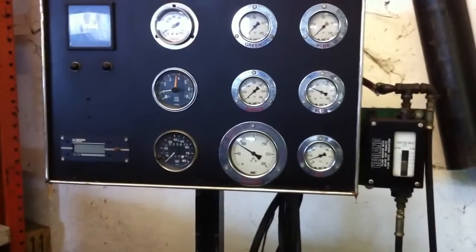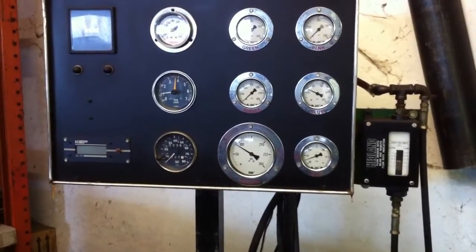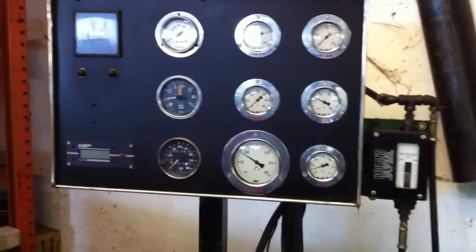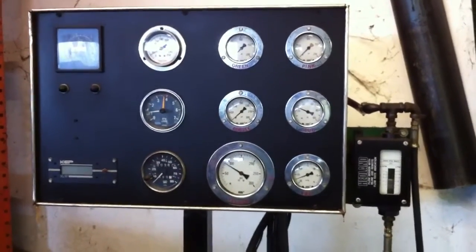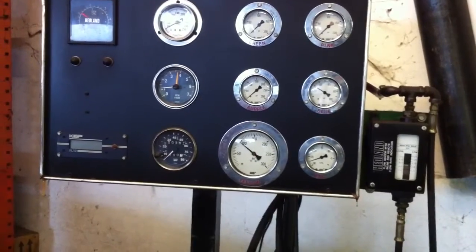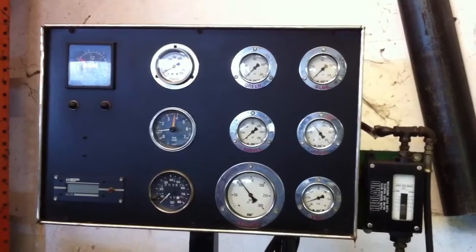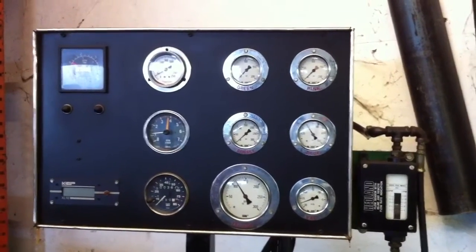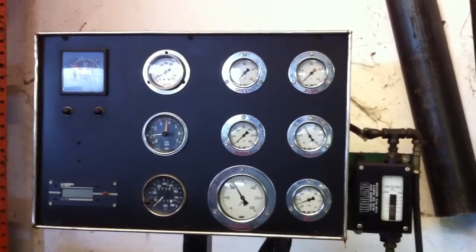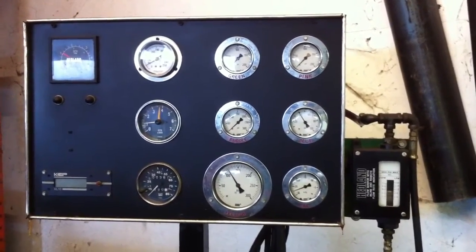In the van I was getting 85 psi. I did a max throttle acceleration holding the brake, stall testing the unit, and this was all I got for an increase in pressure - it went up to 110 psi. So 110 psi is not enough to hold the clutches and the transmission will burn up. The failure we had is that we lost second and fourth gear bands.